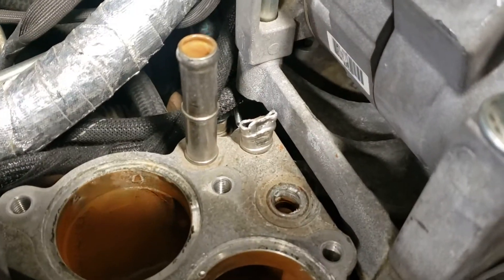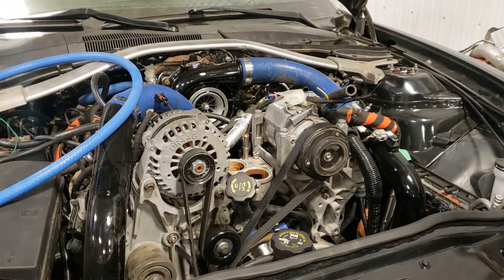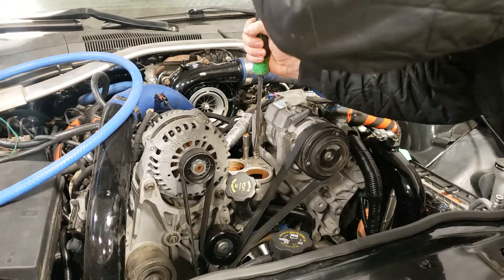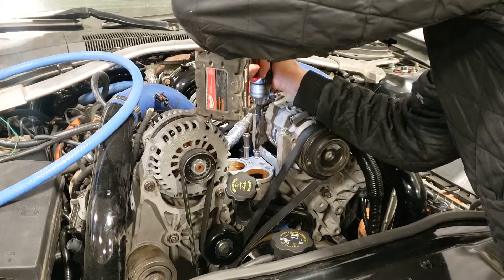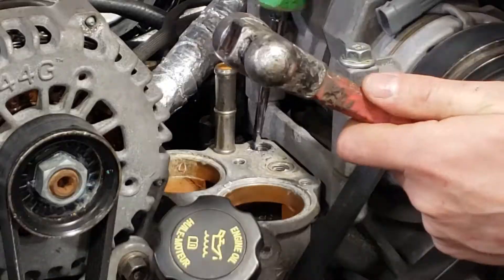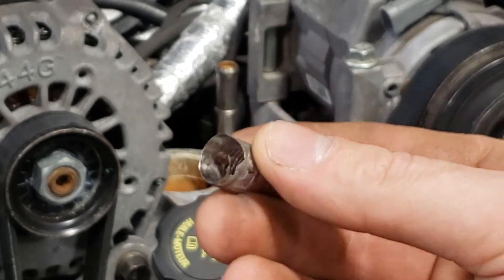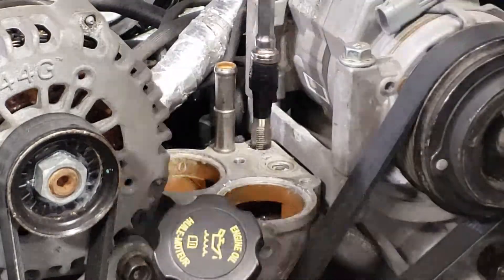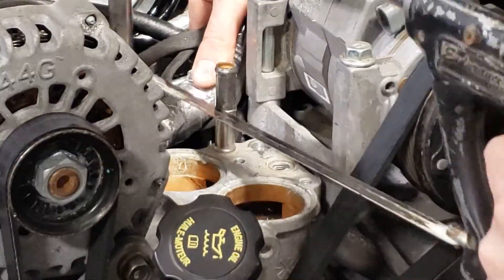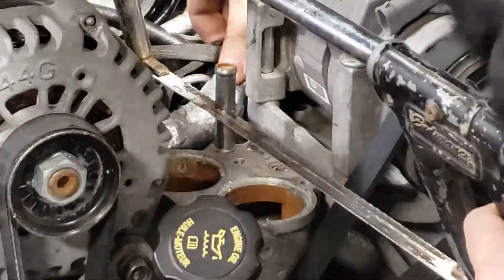On the top of the thermostat housing there are two pipes sticking out of it — half inch heater hose. One goes to the turbo and the other one is for something in the emissions. I want to get one of them out and tap it so I can put a thermostatic switch in there, possibly for one of my cooling fans. The other cooling fan I think I'm going to run off intake air temp — I'm not 100% sure yet, but I just want to have this option for later if I can't get the ECM to control my factory fan relay. I ended up having to drill this thing out after hitting it with a slide hammer and chipping away at it with a flat screwdriver, but after all the fighting I finally got the piece out and was able to tap it with a quarter-inch tap. The other one sticks up a little further than I liked, and that half inch hose wanted to kink over when I looped it down to the turbo, so I just took a hacksaw and trimmed it up — there's a nice little ridge about halfway down so you still get a good clamp and it won't slide off once you clamp it.